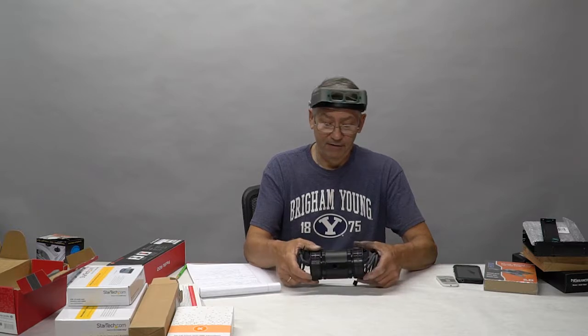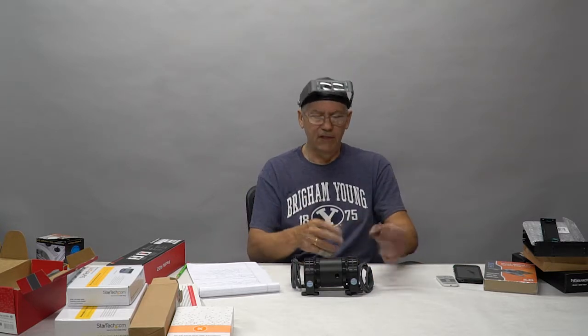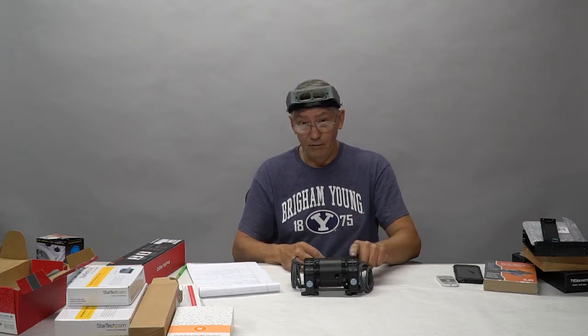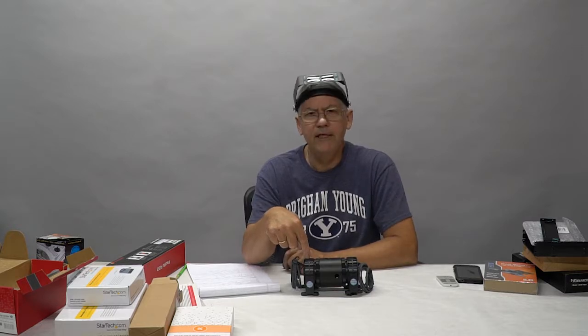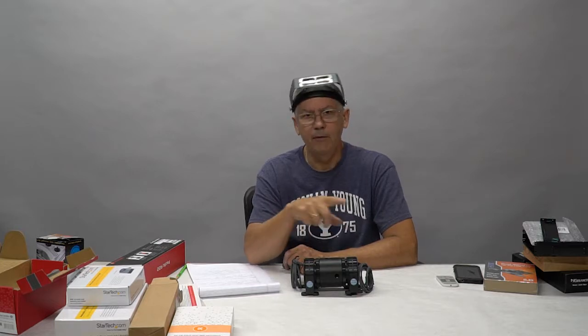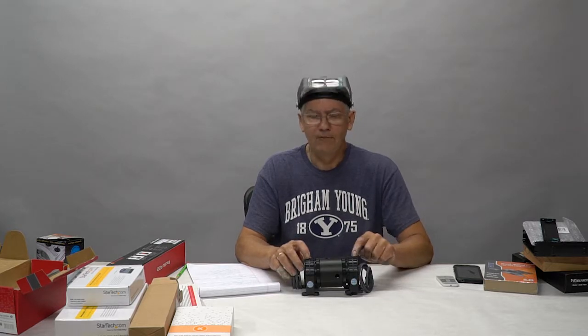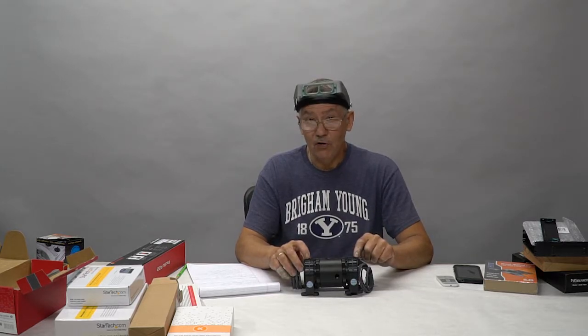This is a dual pump setup, so you have both pumps running in serial. So what we can do is we can set one pump up to run during the normal temperature scheme. So we can say we wanted it 25% at low temps and 50% at medium temps and 100% at high temps. And when we start getting up into our high temps, we're going to have pump number 2 kick in. Now pump number 2 will add to the cooling, so it will increase the amount of liters per minute that they're traveling through the system. It also picks up so that if this pump were to ever fail, and the temperature started to go up, number 2 pump automatically kicks in. You don't even think about it.